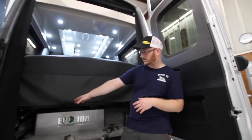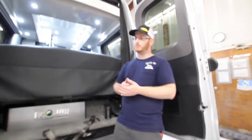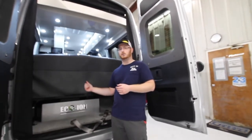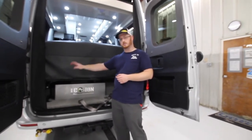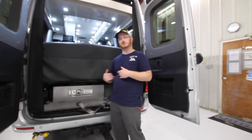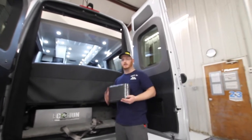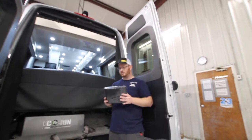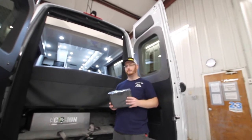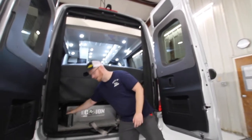On the left-hand side, we have our transfer box. You don't want to keep a lot of things around that. What the transfer box does is go from shore power to the system when you're plugged in. When you unplug from shore power and turn on your generator, it will switch automatically to generator power with a slight delay before it engages. In this case, there's also a tire filler and fix-a-flat. If you get a nail in the tire, you can slowly fill the tire and put the fix-a-flat in it to fill the leak.